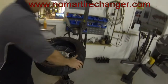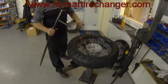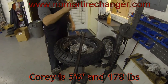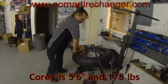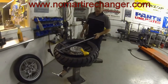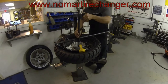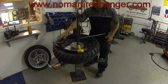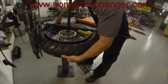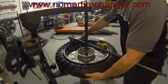Take the tire and push it down — this is a brand new tire by the way. Take your demount bar, put the double end on the wheel like so. Use our yellow ring tool, put that on the wheel. The GS wheel is a little thick so it can be a little snug, but it does go on just fine. Step around to this side of the bar, push the bar to my hip, use my hand to steady it. Set my center post. Drive with my hip, use my hand to steady it, push it around. Use my free hand to push the tire to the drop center. Sometimes you will need to reach underneath and pull up a little bit — as you're pushing with the bar, you pull up. You'll see the tire draw in. And it's on.